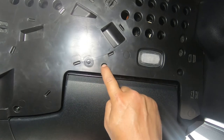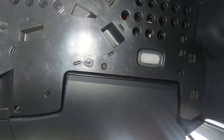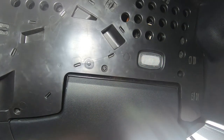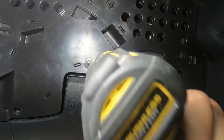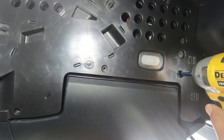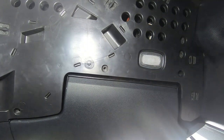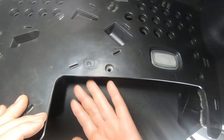The cabin filter is usually on your passenger side, right underneath your glove box. We want to go underneath and remove this lower panel. There are three screws you need to remove — T20 — there's one here, one here, and another one right here. You need to remove all three so that you can lower this lower panel. Once removed, we can lower the panel and we can already see the cabin filter.